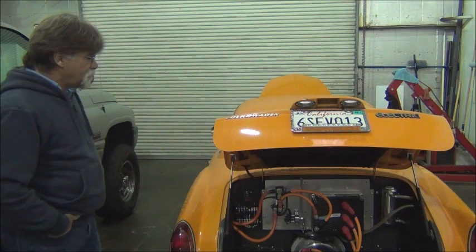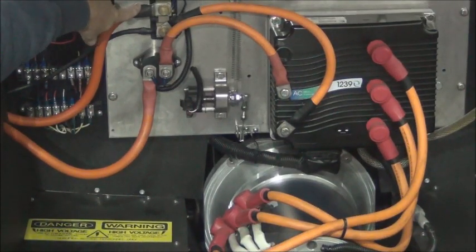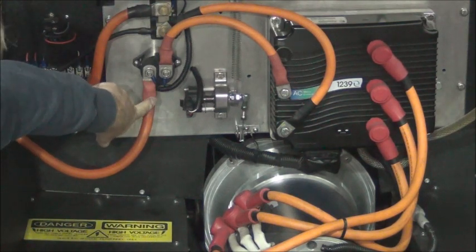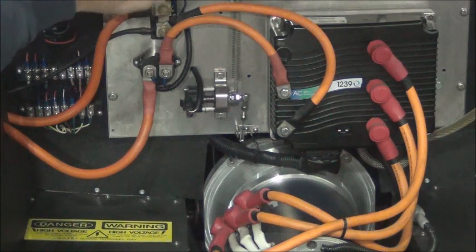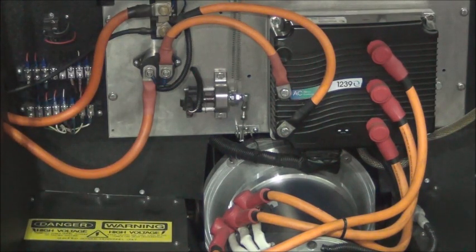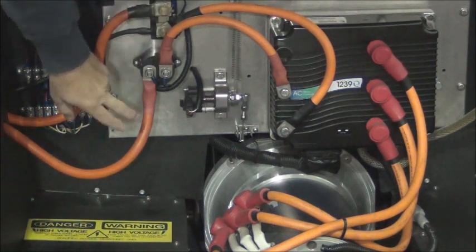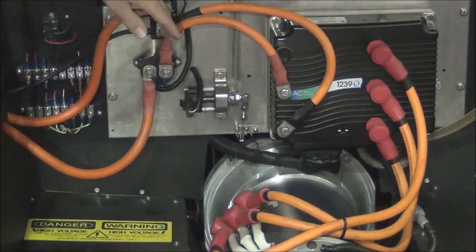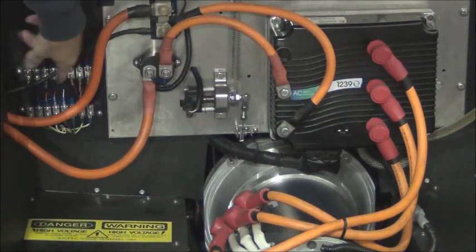What's involved today? Here's the main contactor — let me zoom in so you can see these things a little better. What we have here is our shunt. Below here is our main contactor, here's our throttle, and of course our controller and motor. It's easy to get to. We're going to disconnect the battery — the traction pack — turn off our main power switch, disconnect the negative cable on the 12-volt battery, and then disconnect this contactor wiring. We've got our high-voltage leads coming in, our pre-charge wires that connect there, and then the coil power wires that go out to our contact port.